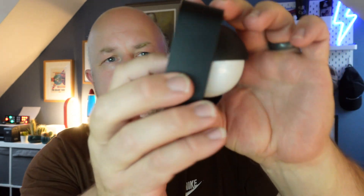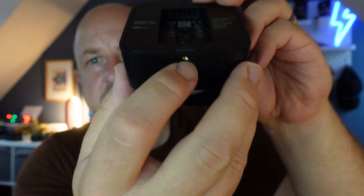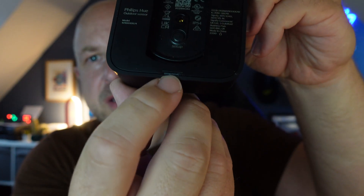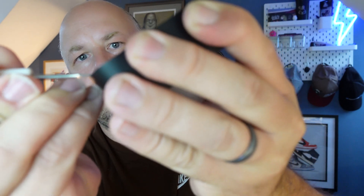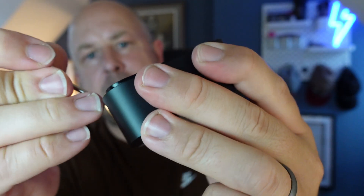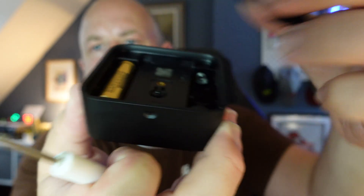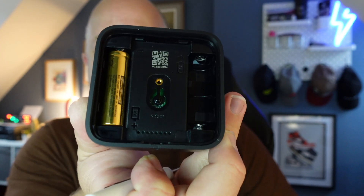Before we set things up, here's how to access the batteries. There's a Phillips head screw here and one on the bottom — remove both and you'll see a small lip. Get a flat screwdriver in there; it is relatively stiff, but carefully force it up. It only comes up a few millimetres then opens up around all the sides. That's how you replace the batteries in the Philips Hue outdoor sensor.